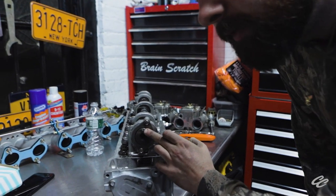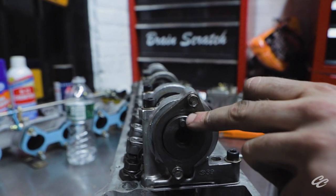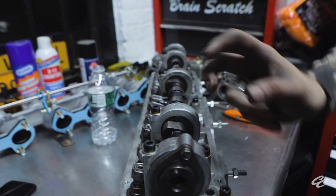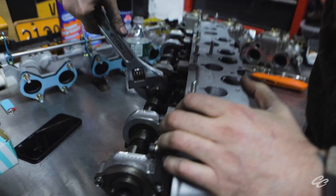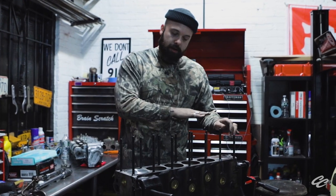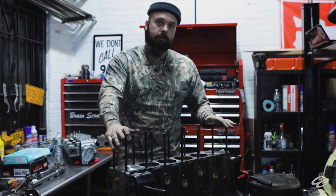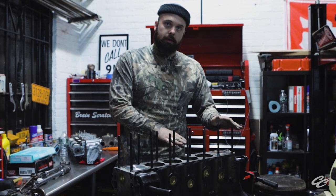We want to align our dowel here for the timing gear up with that slotted groove. We're going to give it a slight rotation clockwise so that these two line up. You'll also notice that that has both cam lobes in the front pointed up in a Y fashion. You'll see what I'm talking about with the interference when you start rotating this thing. Boom — there we go. That's it, that's where it needs to be. Also, before we put our gasket on, we're going to give this thing one more wipe down with some brake clean. Make sure the surface is free of any contaminants because the gasket goes on dry. We need this thing smooth as possible — no oil residue, nothing on the surface of the block.